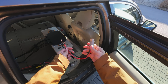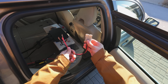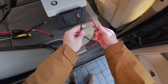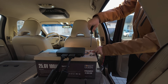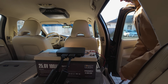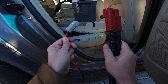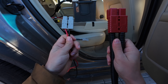To avoid the hassle of constantly switching cables between the car's electrical system and external batteries, I'm making custom wiring with battery connectors. It's important to choose cables thick enough to handle their length and the expected current load, as well as the appropriate connector. The current connector is rated for up to 50 amps, so I've ordered more robust 350-amp connectors and will upgrade the entire system to use them.